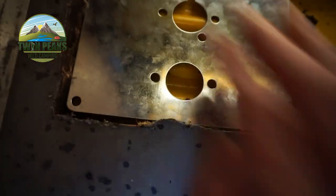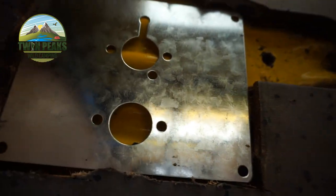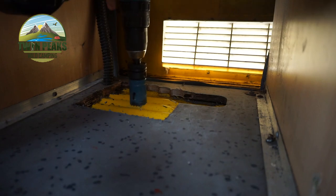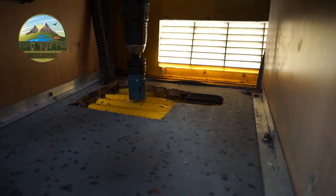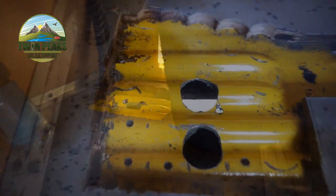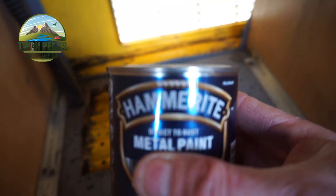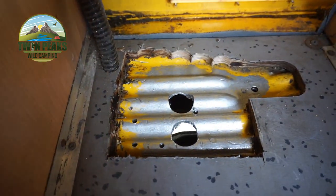The base plate's gonna go there, so what I'm gonna do is get a pencil, mark out for the holes - there'll be the four outside ones and another hole for the fuel line. So I'll drill them and I'll bring you back. Right guys, there's the two holes. What I'm gonna do now, I've got some Hammerite metal paint. I'm just gonna paint around the holes to stop it rusting. I've finished painting that now. I'll let that dry.